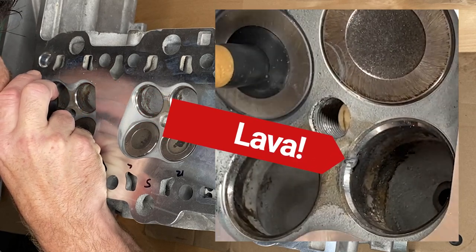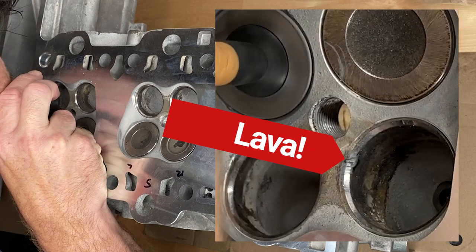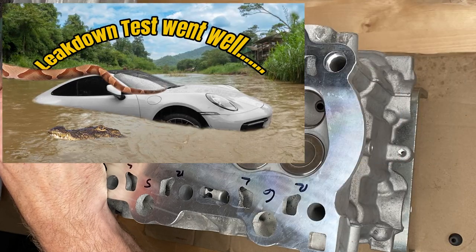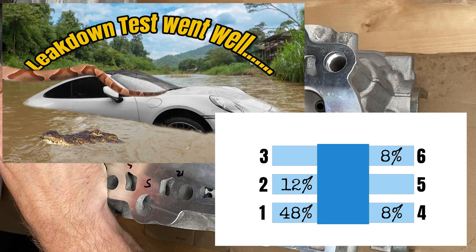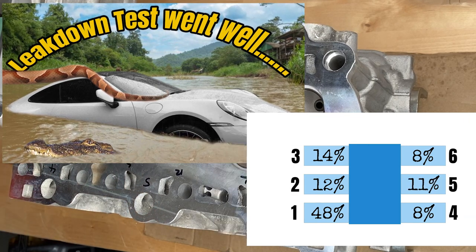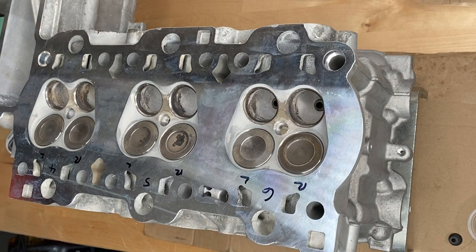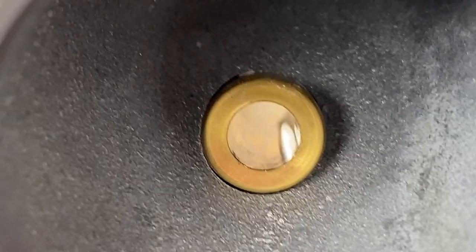That lump of lava there is one of the things they were talking about — some sort of carbon deposit stuck right onto the valve seat. If you remember back to the leak down test we did in episode 4, it's really no surprise that these valves wouldn't seal if after all this cleaning we still have these deposits sitting right on the seats. Take a look at that black blob — that is a valve guide for the exhaust; they all look like that. Take a look at the intake side — that's what they should look like, more or less brand new.